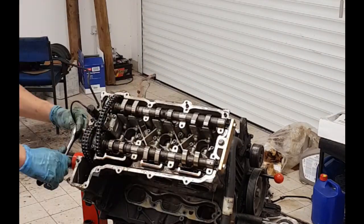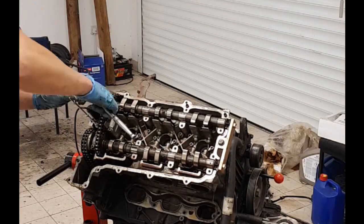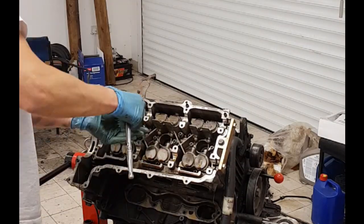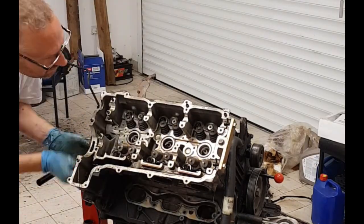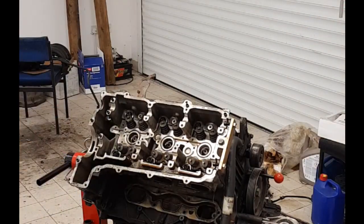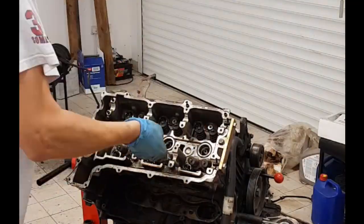It's all very nice and clean in there, which I was very relieved to see. The camshafts and journals are all in good condition. I then clamp down the metal on there — that's just to hold the solenoid together for the variable valve timing. The camshafts are out, then I remove the tappet chest, which enabled me to have a look at the head. Now I'm going to undo the head — there are four small bolts on the left-hand side which need to be undone, then move on to the main cylinder head bolts.